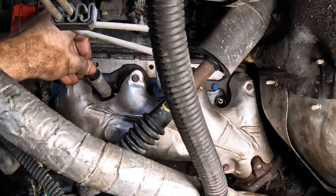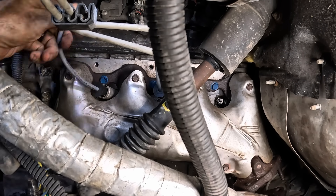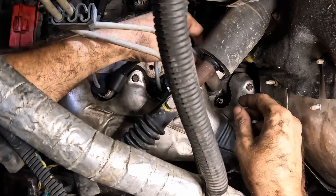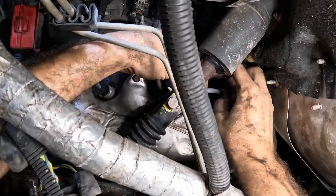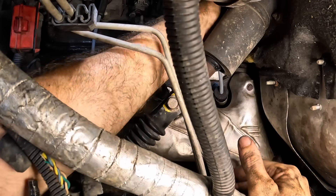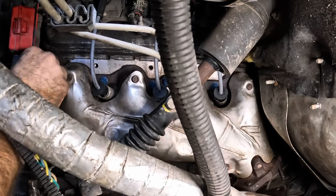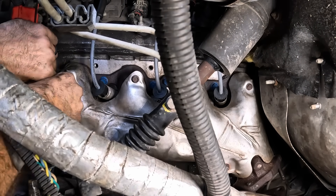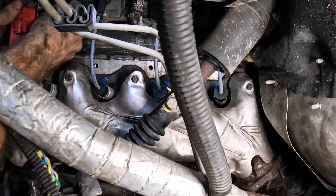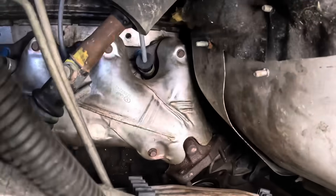The very couch that has caused me so much agony is beckoning for my presence. Put that on there. Heat shield installed, almost forgot — put that guy in, and then back up top on the coil. Okay, good. Now we can put that Y-pipe on. Make sure my gasket's still aligned — and it is good. I've got new nuts to make the install because I welded the old nuts to the cylinder head.